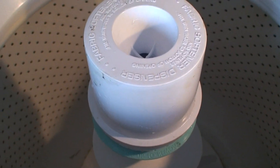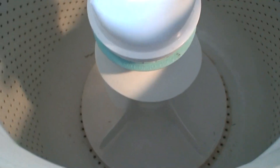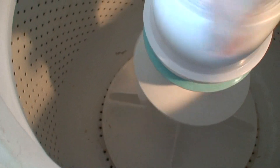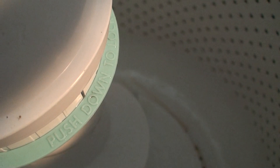Tilting it on its side freed it — now you can see. I couldn't do that earlier, but if I turn the clutch one way, it locks up in either direction after a couple turns. So even though the clutch is locked up, the motor still turns by hand. Let's plug it back in out of curiosity and see if it re-locks up again. If it does, I'll have to pull it apart. Moment of truth. Nothing. So while this freed up, a little dry agitate — nope. For some reason it doesn't want to turn. Next step is pull it apart, I guess.